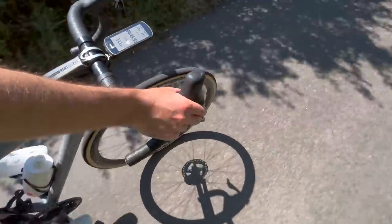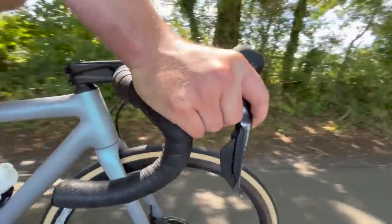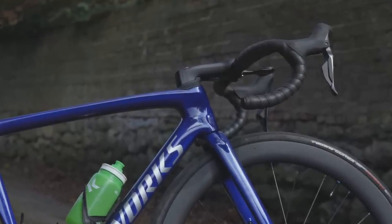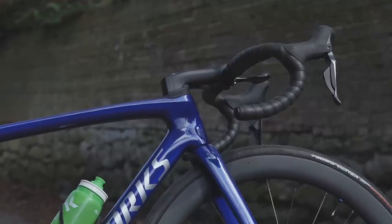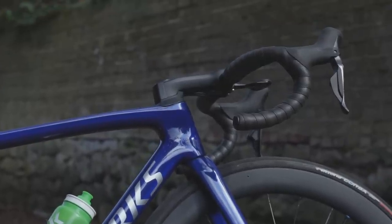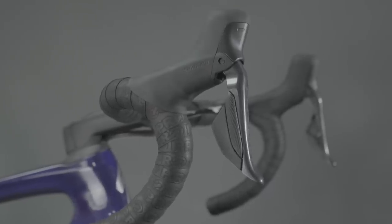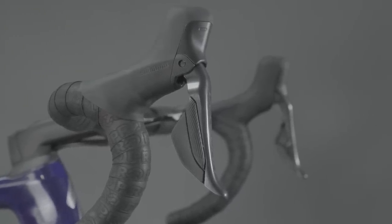Let's head up to the front of the bike. Aesthetically, the biggest change comes with the shape of the shifters. The body has been made longer and taller, both of which I personally like. Shimano says it's due to feedback from the pros, but I suspect they needed to fit the CR1632 coin cell battery in each shifter, and that played more of a role. With my medium-sized hands I found the new shifters very comfortable — it's a secure grip on bumpy roads. The bottom profiles have been altered and are now very pronounced. The new levers are better, with fewer missed shifts. There's plenty of free stroke and position adjustment so you can physically tune the levers to your hands.